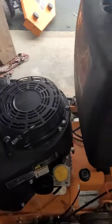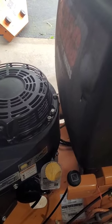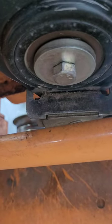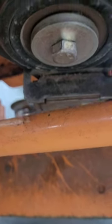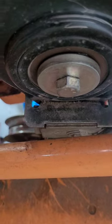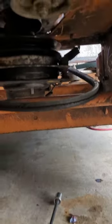I've pushed the engine back about two inches, which is all we'll need. When you look down here, you can now see enough clearance between that bolt and that axle to get an impact on there. That's why you need the impact — so the engine just doesn't turn when you go to wrench it off. I'm gonna connect the impact now.